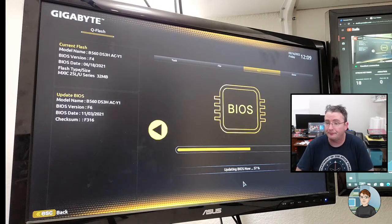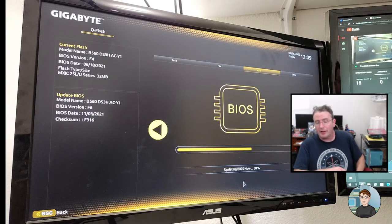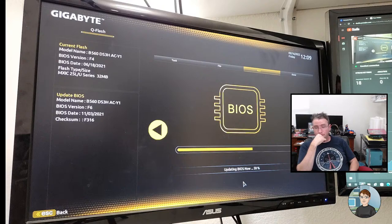to hopefully fix that. So moving the mouse around, another thing you could try is plugging the mouse into a different port on the computer. But I would think more than likely a BIOS update or driver updates would fix it. And I don't mean just for the mouse, but like the graphics, sound, network, Wi-Fi, Ethernet, you know, as much as you can update and see if the problem goes away. You could also disconnect the solid state drive, put back in your hard drive, and see if the problem is now in Windows 8. So something else could have gone wrong.